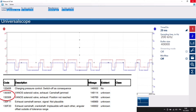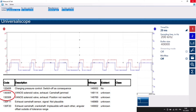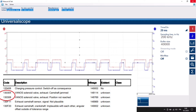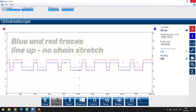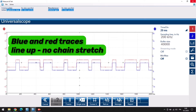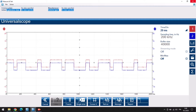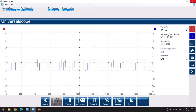As I covered in my other video about timing chain problems: if you unplug the VANOS solenoids and start the engine, the VANOS sprockets should remain in their initial position according to the return spring principle. If they both line up exactly like that, you know you definitely haven't got any stretch in your timing chain. If the intake blue trace is to the right of the red trace, that's how you'd identify a stretched chain. That's why scopes are really mega useful.